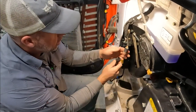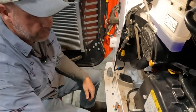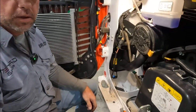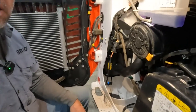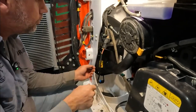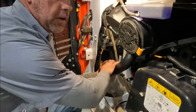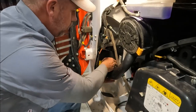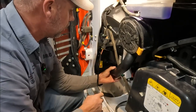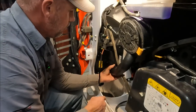Before I put the lock piece in there, I'm just going to see if I can get this to plug up and test it. Go turn the ignition on real quick. Yeah, it did come on. So it's not a strong vacuum, but it's definitely pulling a vacuum through there.